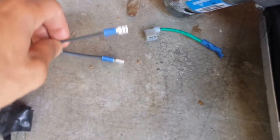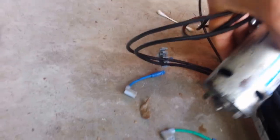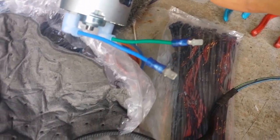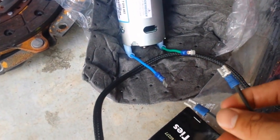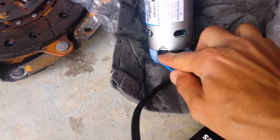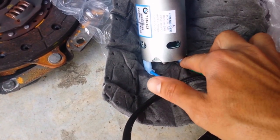The first thing is to prep your new wiring, depending on how corroded your wires are on the bottom of your old motor. I snipped the old connections off. The new motor comes with new connectors that have male ends, so attach female quick disconnects to your wiring — which I already did. Connect blue with blue, green with green, and tape them up — all you'll have to do is connect from the bottom with the two female-to-male ports.